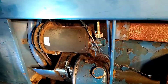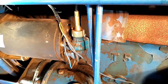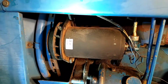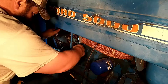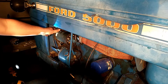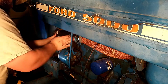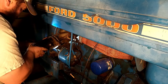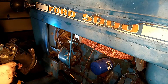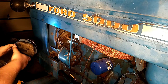It doesn't look like the generator will be too big a deal to take off. There are some spade connectors on the back that we'll just pull off. We've got the TAC cable and three bolts and a couple bolts under here for the bracket, so we'll slide that off. Generator out. And those are the brushes, all in pieces here in the back — probably is our problem.